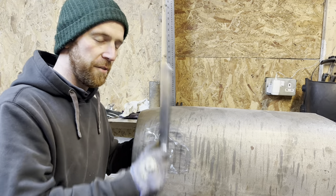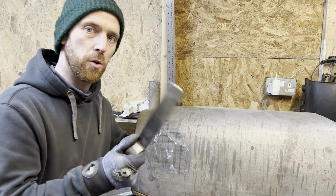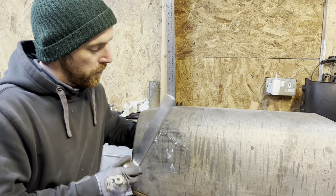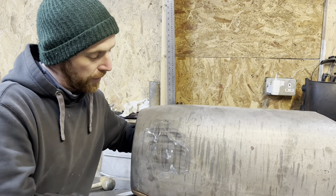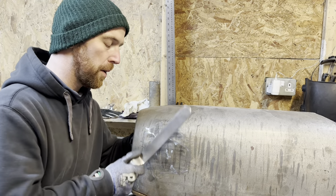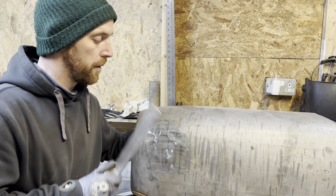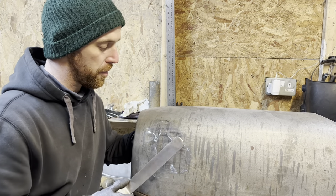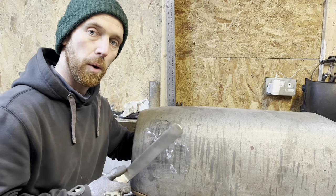The technique I'm using is a downwards action. I'm not using the slapper like a hammer — even though these are basically long-faced hammers. What I'm doing is striking down and flicking off, exaggerated like that. I'm not hitting it with a blow; I'm literally glancing the face of the metal to bring it out. That technique we'll use more later in the process, but for this moment I just want to strike the panel down to bring it out quite quickly.